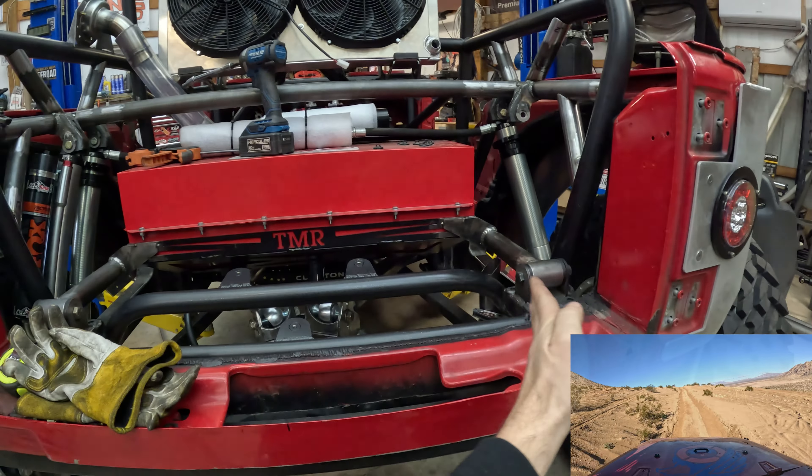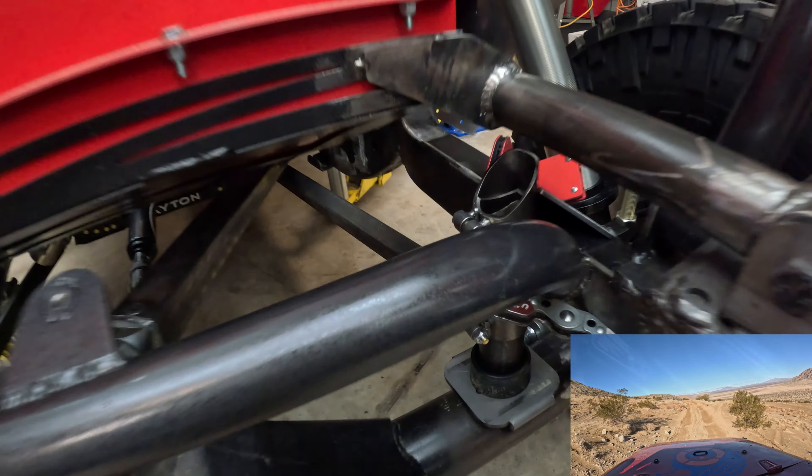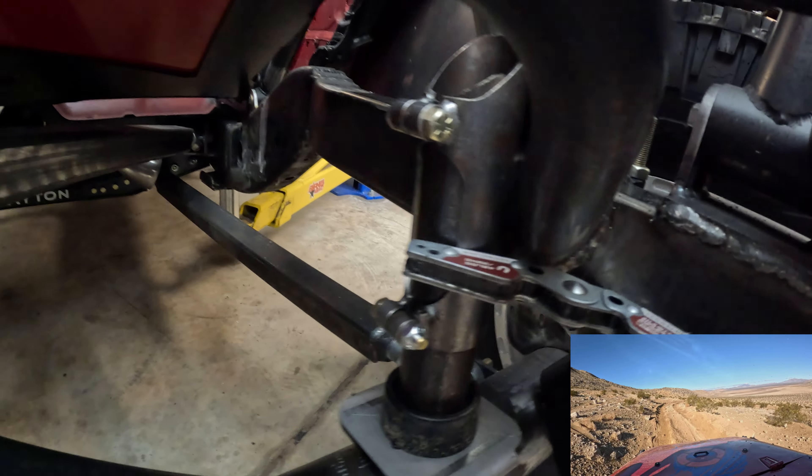Bumping at flex is never the same as a level-ground bump. What you actually have to do is build an axle pad that is offset in the direction it moves and bumps at that angle, as opposed to flat - it's tricky to discuss without showing you. The more inboard you mount these the worse it gets, so that's enough yapping. Let's tack these up, bring it over to the bench, weld it up, then bring it back and weld it to the frame.